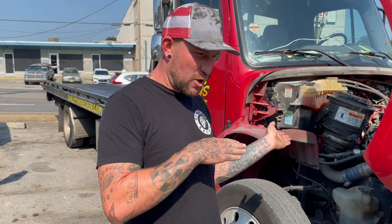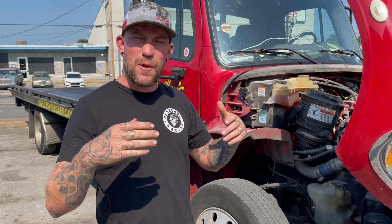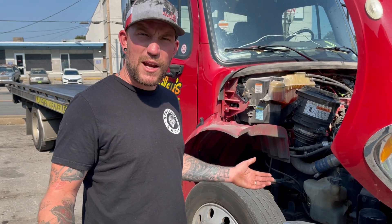As I start to gain more torque and speed going up the hill, I need a bigger turbo because the turbo is winding out. The actuator will slowly open up that vane, changing the diameter of the turbo and making it bigger so I can run more boost off of it. It's the best of both worlds — small turbo power right out of the gate, boosting right away, and then when you need more power at higher RPMs, it becomes a whole lot bigger.